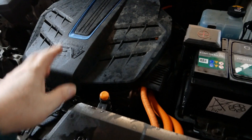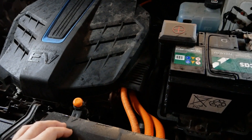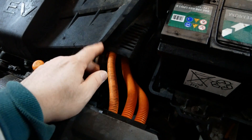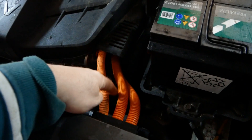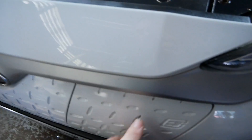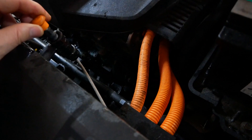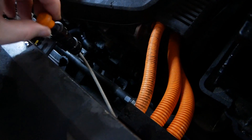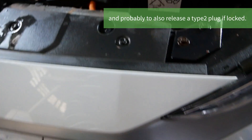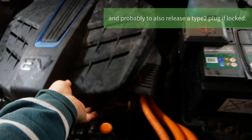This is actually my first time looking under the bonnet on a Kona. With all electric vehicles and hybrids, anything that is orange is high voltage. In this case there are three orange cables coming from the charge port at the front, and there's also a cable with a pull-out top which I'd imagine is the emergency release to release the cover if there's no power.